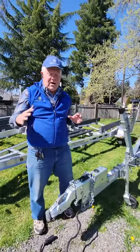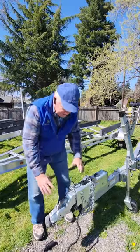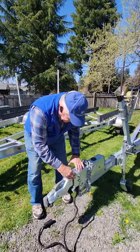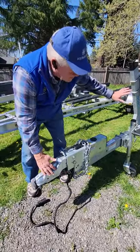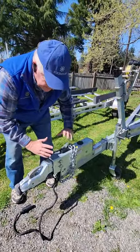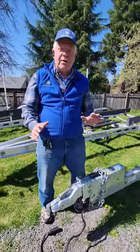When you go to stop the car, the car stops and the trailer pushes on the car. That makes this go inside here and pressurizes the brake master cylinder, which pressurizes the brakes and slows it down to reduce that compression.